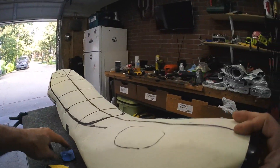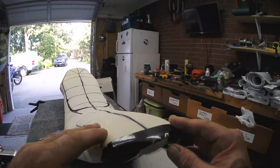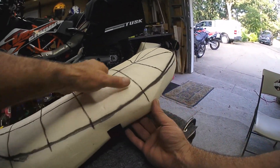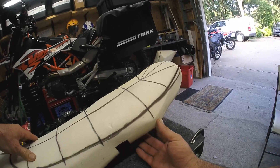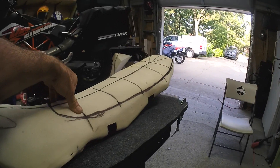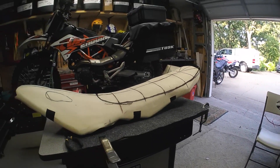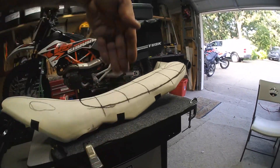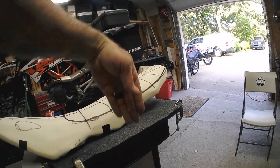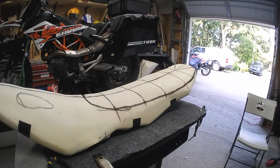It will be slightly lower than the Seat Concepts seat, which is kind of the whole idea for me. I'm a very short guy, so with the Kubalink and this seat mod and lowering the front forks to match the Kubalink spec, I should be in business — especially when the bike has a load. I may even get a good bit of both feet on the ground. Currently, at full adjustment with no luggage, I can ballet one tippy-toe down — that's about it — with a cramping calf muscle on one foot and the bike leaning. This is a highly mandatory mod for me.